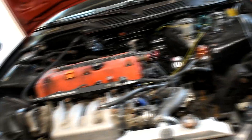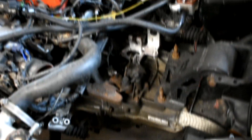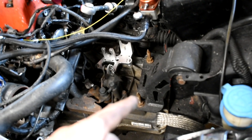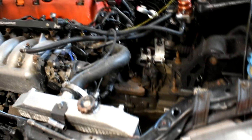I've been hammering down on this pig here. I got both axles out, she's pretty much ready to roll. Shift cables are off, slave is off, any unnecessary plugs and grounds are off. I just got to take the housing bolts off and this mount bolt and it should be ready to drop out. I'm here by myself so there's not much recording going on, but we're gonna get this trans out as soon as possible and dig into it to see how bad it is.